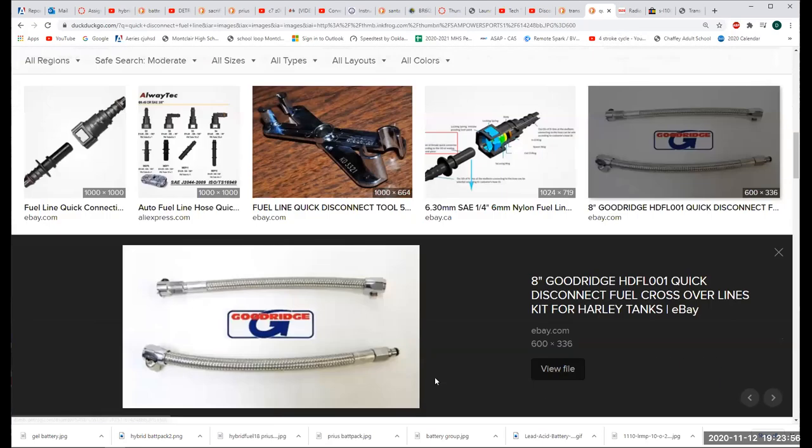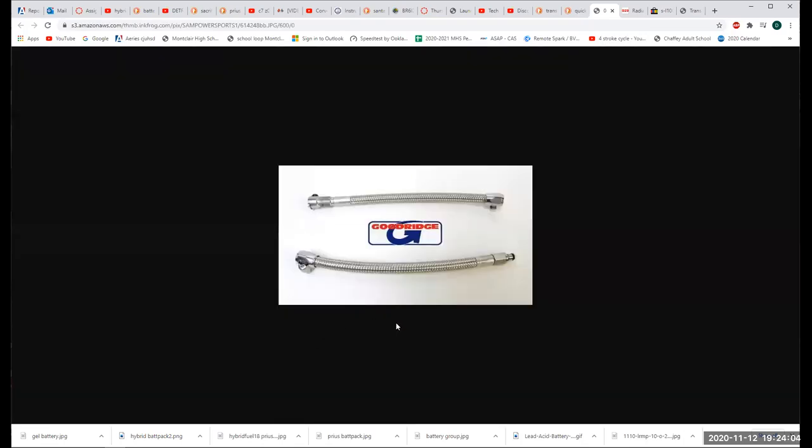This right here is the steel braided line we were talking about when we were talking about brake lines. It's far superior when it comes to protection from impact damage. Problem is, it's pretty much impossible to inspect the rubber hose that's on the inside. In case you're wondering how the steel braid holds pressure, it doesn't. It's just a coating for a rubber hose, and it makes it impossible to inspect because it's got steel braid all over it. So just something to think about.